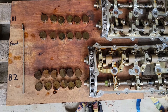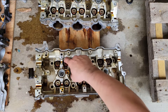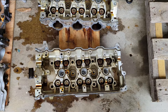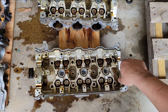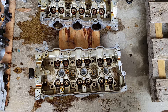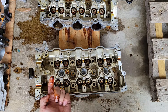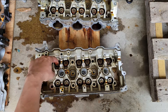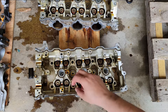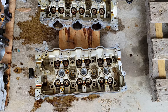Now you can see all of your valves and springs exposed. If you have to take valve springs out, they're all color coded for exhaust and intake side — the orangish-reddish color is for your intake side, and the bright yellow is for the exhaust side. You can't mix and match any of these valves in different spots, because the valve seats, valve length, bore for the lifter, and lifter thickness all coincide to each individual spot where they go.